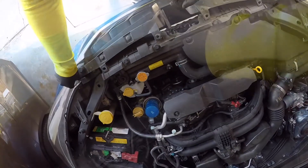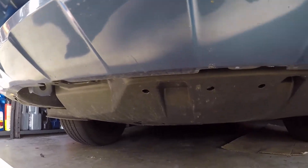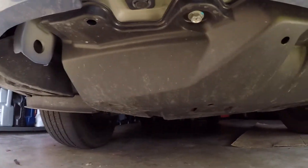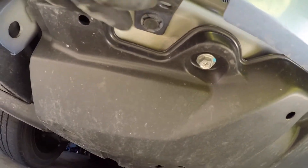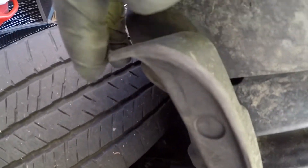This is the bird's eye view of me removing the rivets. There's also going to be one located inside the wheel liner — it's up on that corner and you can just pop it out and remove it. There are also some pop rivets on the bottom of the bumper. These are easy to remove just like the ones on top — you just open it up and completely remove it. On the bottom of the bumper there's a total of eight rivets.